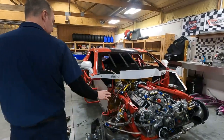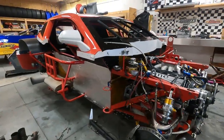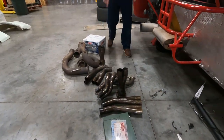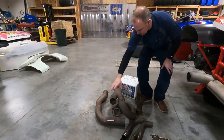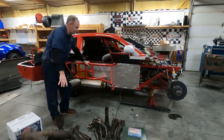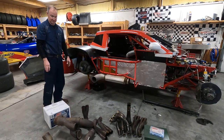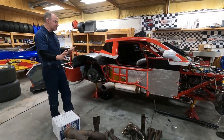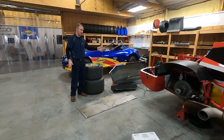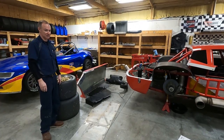You can see how intricate the exhaust system is on this car. The header on the driver's side comes around the back of the engine, and the passenger side does a loop-de-loop so that the overall length of the two primaries are equal. This is three-inch primaries on each side into a big six-inch muffler. If you've never heard one of these cars on the track, they are just amazing. It's all pretty easy to get to once you get everything off — got the under tray off, the tunnel covers off, the side pod off. It's really a good thing that I've got all this room to tear this car apart like this.